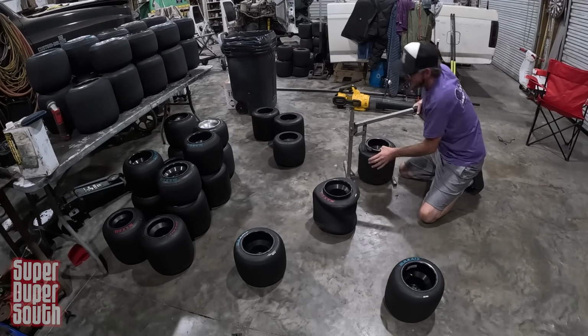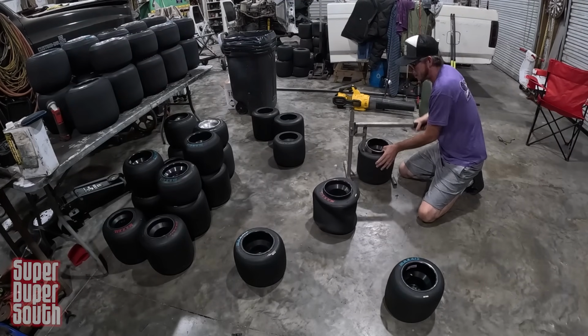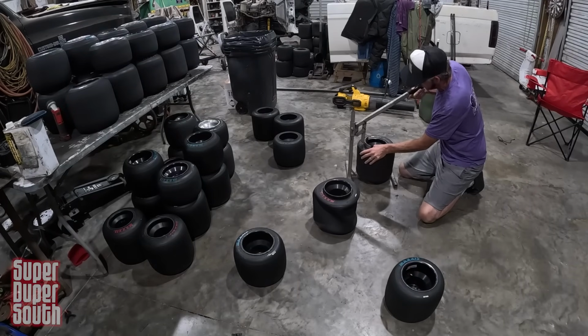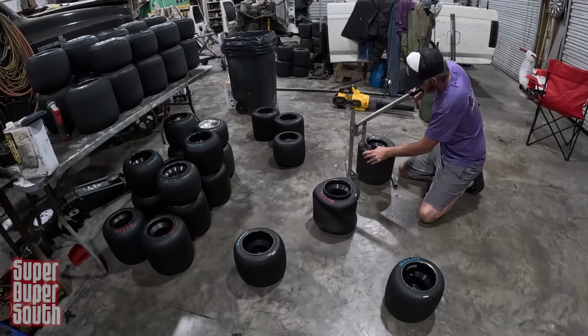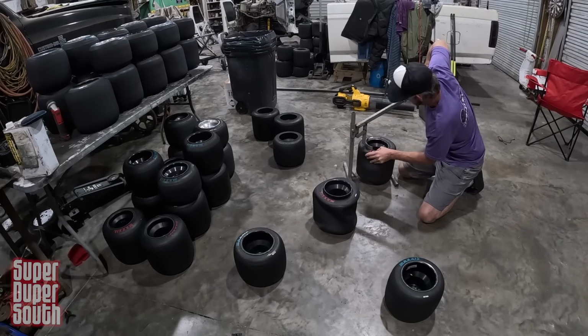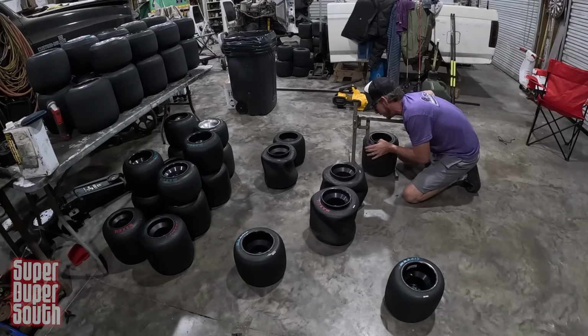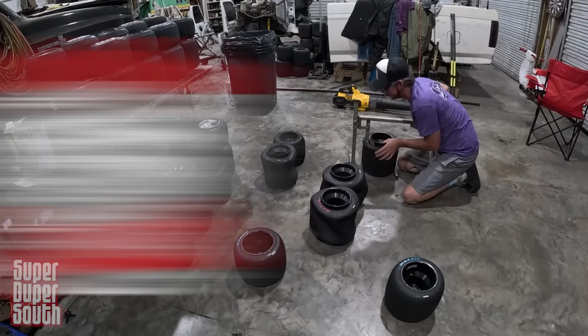A lot of the reason was my left rear had not been flipped, and it was bald, leaving me a little free on top of the racetrack. Once we got her flipped, juiced her back up, we put a hurting in the next race with the same exact set of tires just by simply flipping them. Get some, baby. Come on.